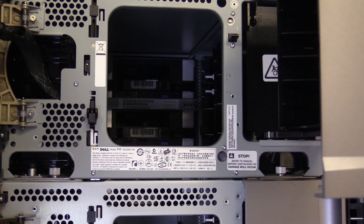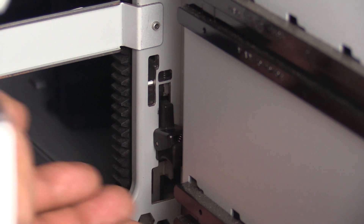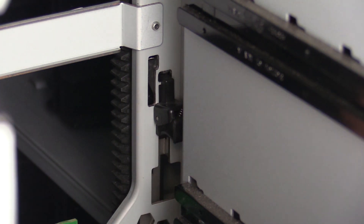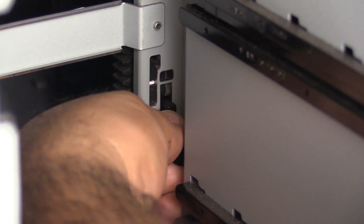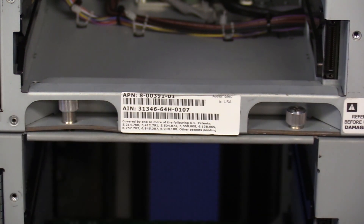To raise the tracks properly, first start with the back of the unit and you must start with the very topmost expansion. Upon looking inside the back of the unit, on the right hand side in front of the empty drive bays, you will see a black squeeze clip — currently in the lowered position. In order to raise it, you will need to squeeze the clip while simultaneously raising the entire assembly upwards. This is the track itself being raised and will provide a bit of resistance as it is spring-loaded. Once you have the track raised as far as it will go, while still keeping upward pressure to hold the track up, release the top half of the squeeze clip. This will lock the track into place in the upward position. While still in the back of the library, repeat this with all other expansions above the control unit, starting from the top and working your way down. The last thing you will do in the back of the library is to undo the thumbscrews holding the expansions to the units below them, located just under the bottom-most tape drive bay. Undo both thumbscrews for all expansions above the control unit.